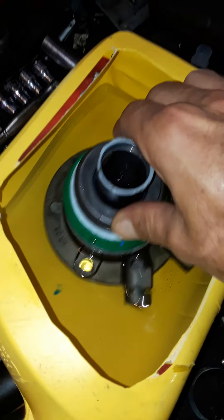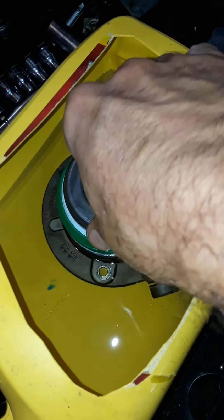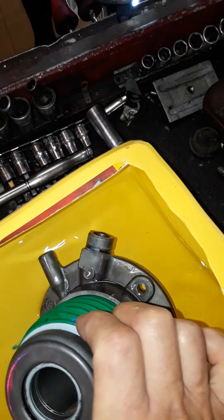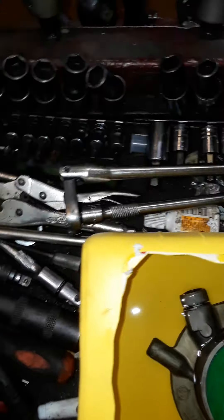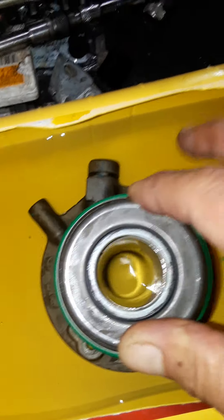You have to apply pressure. You will feel it getting tighter and tighter as you go along. Simple physics says air goes up. It's good to let a little bit of atmospheric pressure get in that hole, and then you turn it over and switch positions. Make sure it's submerged. Switch positions — that's how you try to get brake fluid into this slave which has no bleeder.